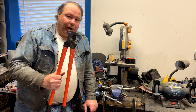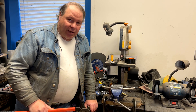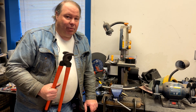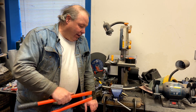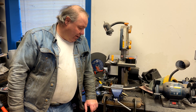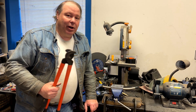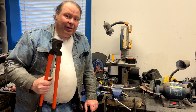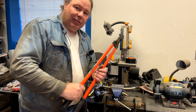Here's one of the professional secrets of building up custom AN lines. This is a set of heavy-duty cable cutters designed to cut bundles of cable, and it works great for cutting hoses like this. Where would you use this? Anywhere you can't get at with a rotary cutter, anywhere where throwing sparks off the braided jacketing on the hose is going to cause problems — like on top of your fuel tank or near a fuel system — and anywhere where you need to keep the hose as clean as possible when you cut it. The downside is you put a little crimp in the hose; the upside is you get a clean connection, no mess, no sparks, and you don't even need safety glasses.